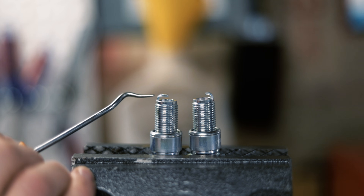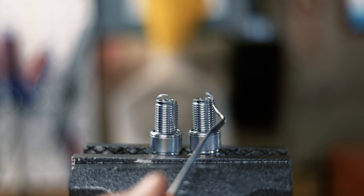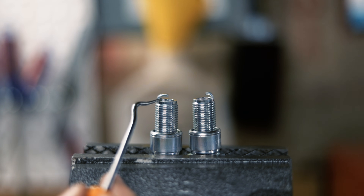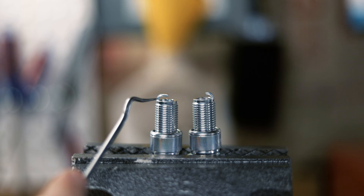This spark plug on the left is normal and the spark plug on the right is side gapped. The normal spark plug has an electrode that is covered by the grounding electrode, and when it sparks, the spark is hidden from the combustion chamber and goes out to the sides. So you don't get as hot of a spark or as direct of a spark.